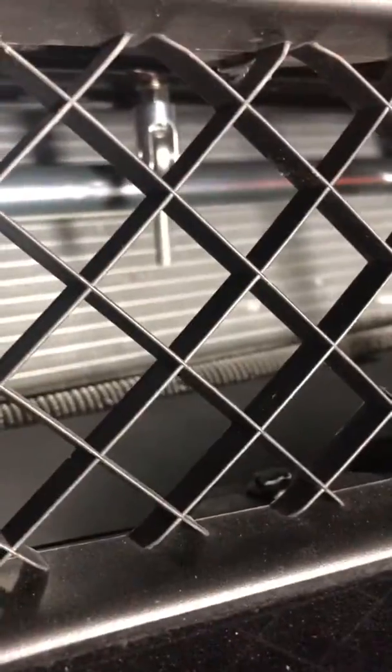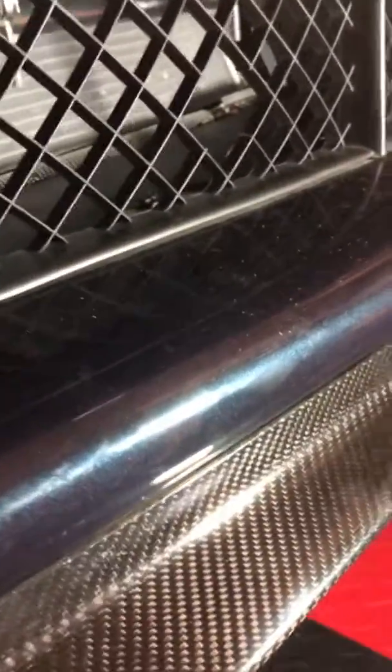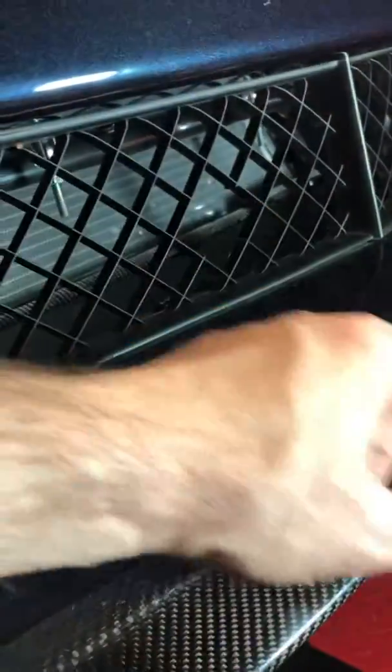But in here, basically, you can see the little hangers there where I'm going to run the supports for the splitter. Now remember, the splitter sticks out 5 inches from the stock splitter. And what I may do is there's enough meat back behind here, not on this first lip, but back here. I'll probably actually screw the plywood right up through there, drill some pilot holes, screw it. I may even get some of those little metal backings in there to help hold it on. This is kind of a long reach. It's almost 16 inches from there to there, and it's at an angle. It really doesn't do a whole lot. But I've got some other struts that are going to go in this corner.